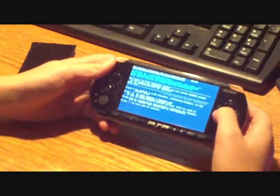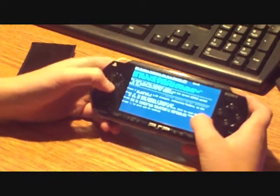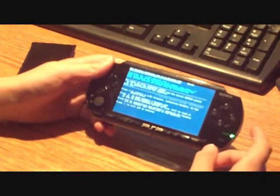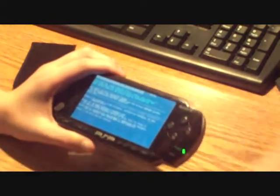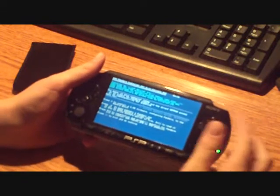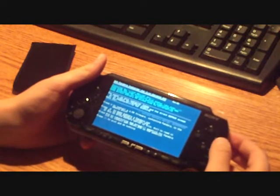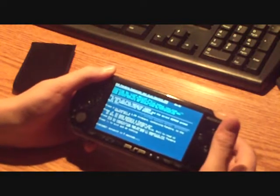Once it's loaded, it's going to say press X to install 1.5 firmware — you don't want that. Then it's going to say press O to make a battery a Pandora one. You're going to want to have a battery inside the PSP that you want to make a Pandora. Make sure you aren't using one of these batteries — they won't work. Make sure you have an original Sony battery, not the newer type. Then press O to make the battery a Pandora one and it's going to say battery Pandora. Then press triangle to exit out.